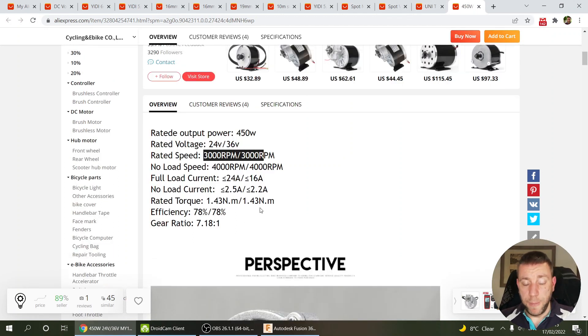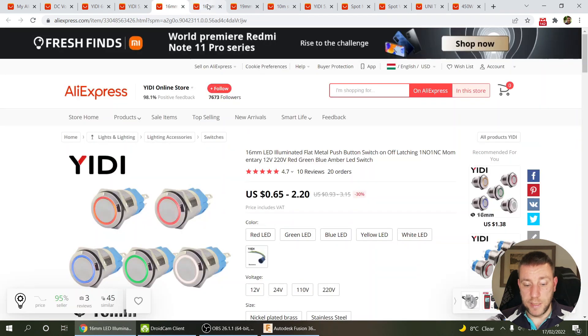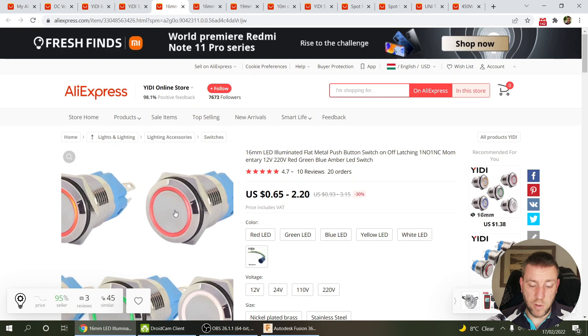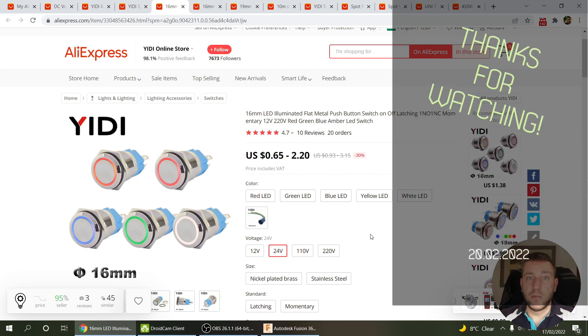For almost all the switches and lights I specified 24V versions, so I don't need any reduction or resistors — I can wire them straight to my 24V system, which is the two batteries in series. I think that would be all for today. I'll definitely post build update videos on the engine. I do have a separate playlist for all my 7.25 gauge stuff, so if you're only interested in that topic you can look at the playlist. Thanks for watching and hopefully see you in the next video.